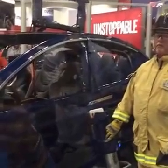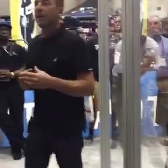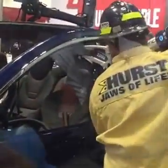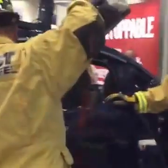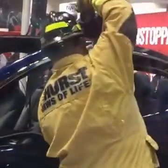I appreciate you all coming out. For those of you viewing this on our Facebook live feed, we appreciate you being with us, and we'll have the guys get started removing the front door of the Model X. We're going to start with a vertical crush modification — the idea is to gather a purchase point in the vehicle so they can get down to that latch, like we do with traditional conventional vehicles, to get the front door off.